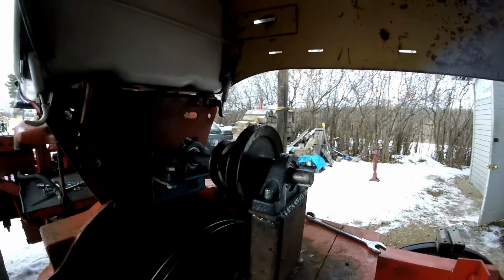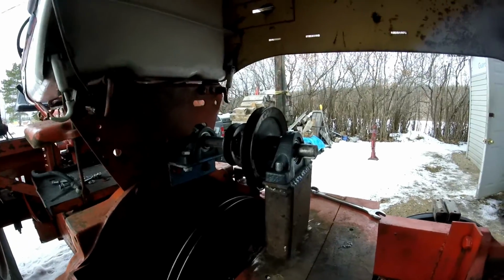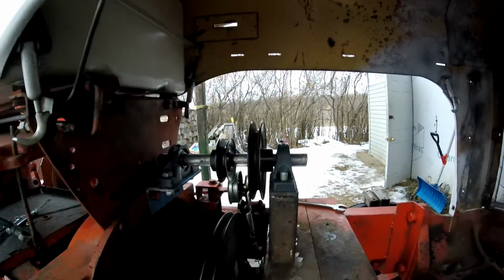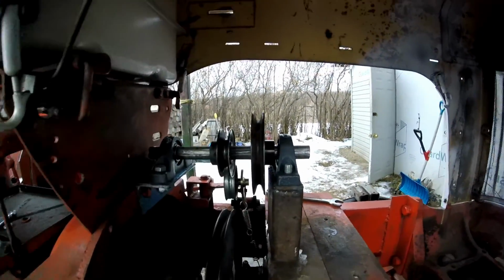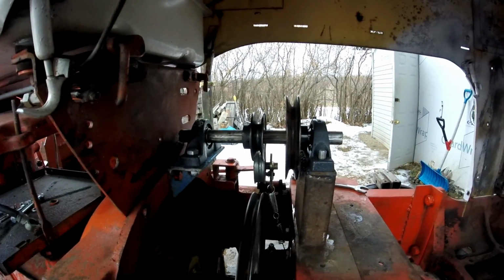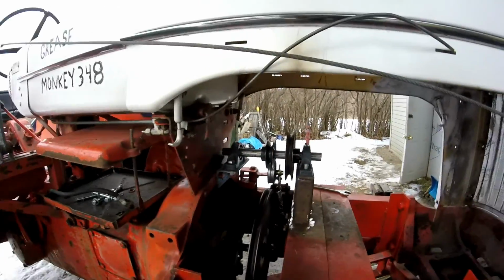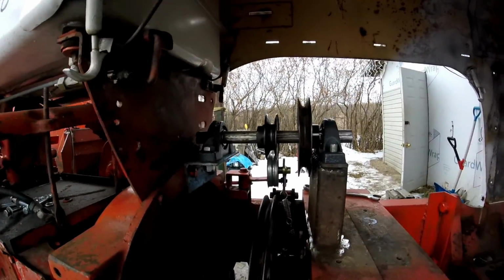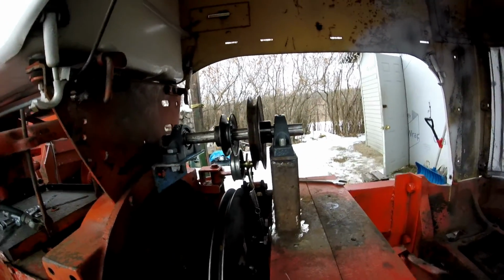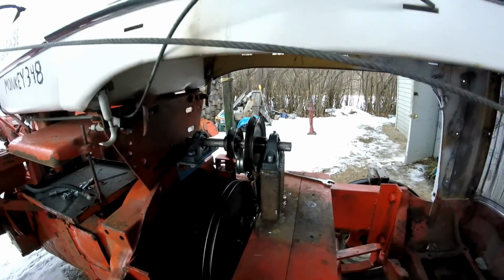So that's sitting there. I gotta weld that into place. And then I got the jack shaft in, just loosely with the pulleys. So I got the 3.5 inch here and a 6-inch there, it's geared down. Then I can put the belt back on. Yeah, so that's what it looked like so far. Next I'm gonna position it nice and straight and then weld this fully.